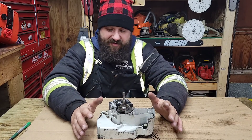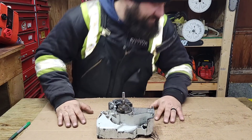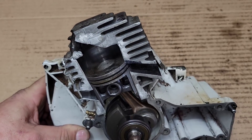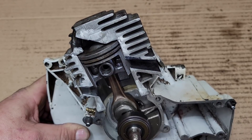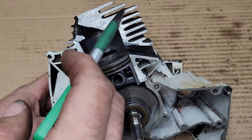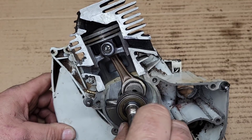How do I pick my timing numbers? I'm going to show you how to pick your timing numbers for a small saw, a big saw, and things of that nature. Here is our chainsaw cutaway. It's a two-stroke — one stroke up, one stroke down, that is the full cycle. A four-stroke has valves in the head that let your intake charge in and your exhaust charge out. A piston-ported two-stroke doesn't have that — it works solely on case vacuum.